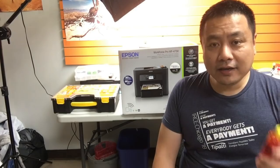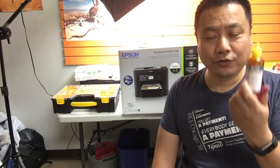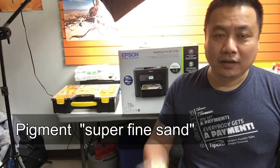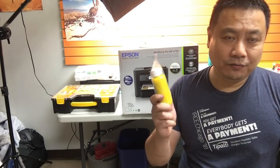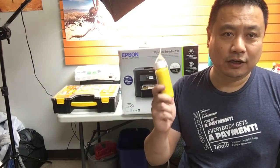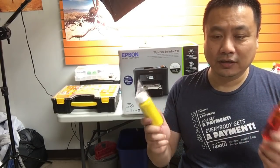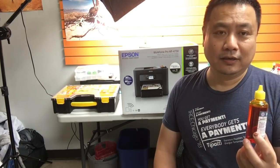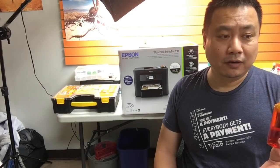Basically, dye ink is like colored salt — when you put water on it, it dissolves. It's very easy to unclog: if it ever gets clogged, just put water on it and you're done. Pigment ink is like liquid sand — if it condenses and clogs, it becomes like concrete. The difference is salt versus concrete. Dye ink is easy to unclog, super cheap, great for photos, and most people can't tell the difference in text quality.